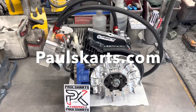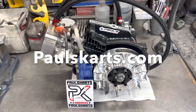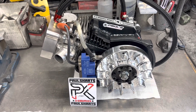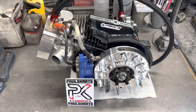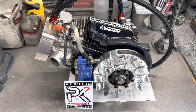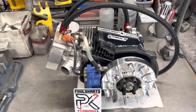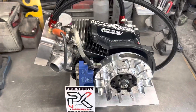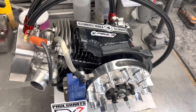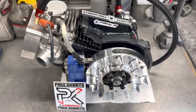Just got done with this engine. I don't know if I've ever built a better engine than this, truthfully. Built some pretty similar. This one here has big features — billet special over billet crank, balanced. Most people don't get the titanium valves, copper seat head, titanium valves — like a $400 option. Welded 3-inch block with a massive 1-inch spine. The thing is so huge, it's like stupid wide. None of that 1/4-inch plate stuff here.